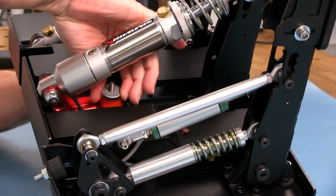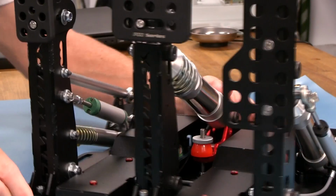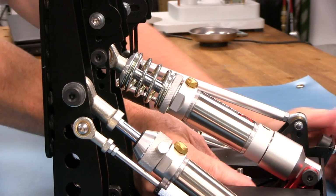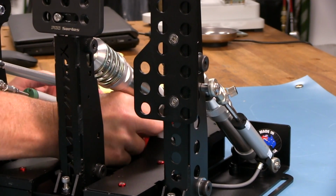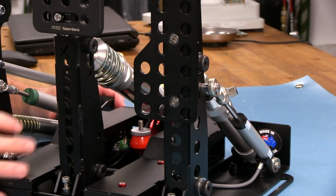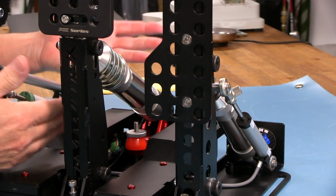it can get difficult if you want a lot of preload on. It's not the easiest thing to get the right angle. You can flip this around, spin these pedals around. I think the best angle I found was coming in through like this, between them at an angle, and then grabbing the nut that way, where I can get the most leverage on it. But even so, after a while it's a little hard on your fingers, these rough knurls on here. Now, you need them, obviously, for the grip, but it's a little rough on your fingers, and it can get hard to turn if you really want to put some serious preload on the bumper. And of course, that's all personal preference.